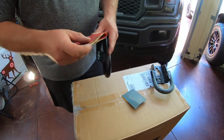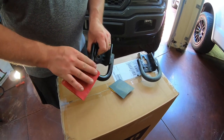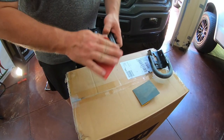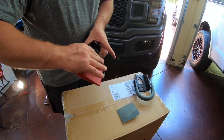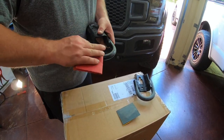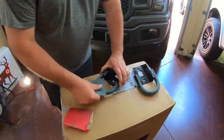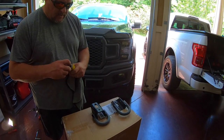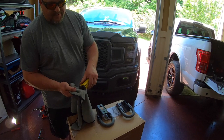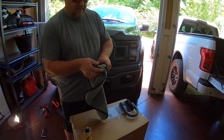Using 150 grit sandpaper, going very light on it. Then I've got a 1000 grit — that's real fine, it knocks down any scratches the 150 puts in. I'd have used 250 probably but didn't have it; if you're light with 150 you'll be all right. They're sanded, so now I'm going to clean them off with some goof off. You can use alcohol or acetone or anything like that — just helps bond a little better and makes sure all the grease is off.